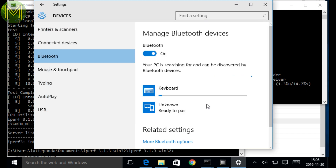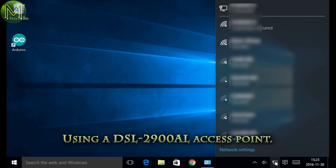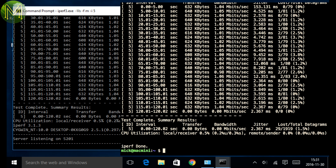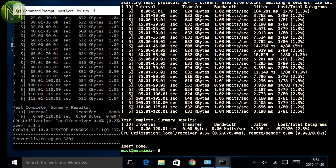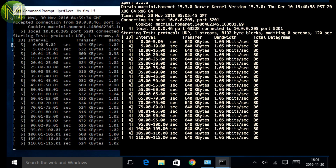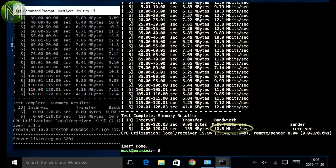Next, testing a Bluetooth keyboard under Windows — no problems there. Next, testing Wifi: I installed iPerf, which is a great cross-platform network benchmarking tool. I first tried out a decent antenna instead of the supplied one, connected it to my access point in the next room, and ran the iPerf benchmark. On UDP I was getting around 2.4ms jitter and 1.5% packet loss, and around 23Mbps on TCP — pretty good. Using the supplied antenna, UDP packet loss increased to around 2.3% and jitter rose to 3.2ms, while TCP came up with the same 23Mbps — so all in all, a pretty decent antenna for what it is. With no antenna, UDP jitter increased to over 11ms with 2.8% packet loss, and it dropped down to 10Mbps on TCP. So make sure you at least use the supplied antenna.